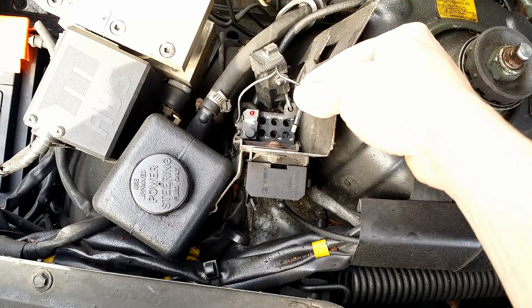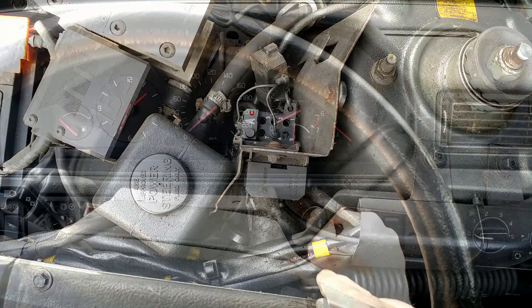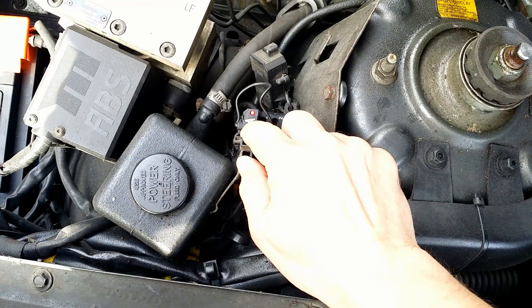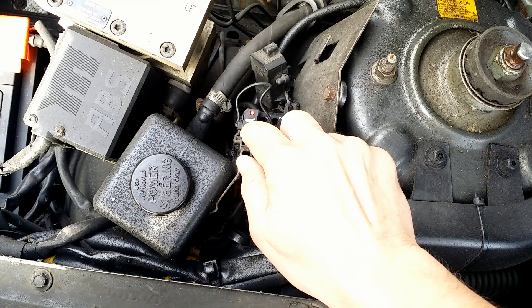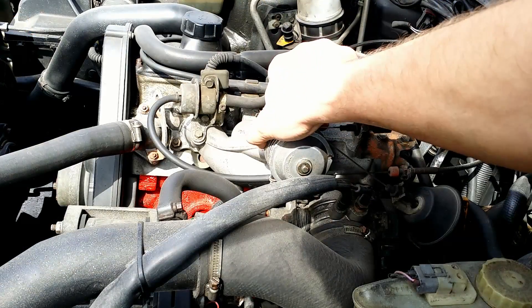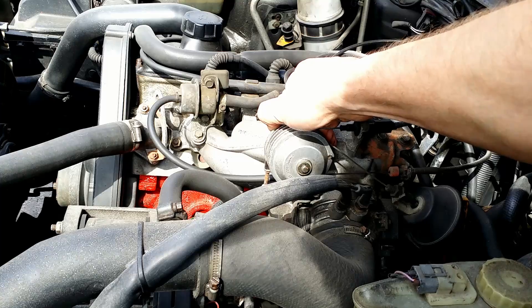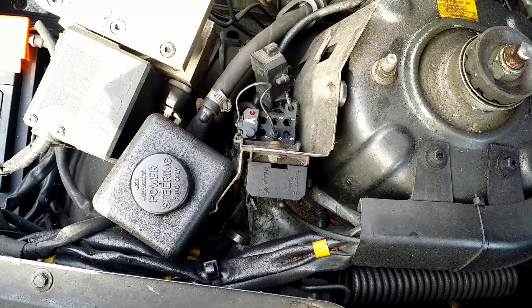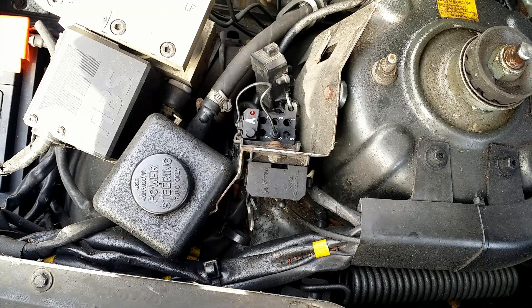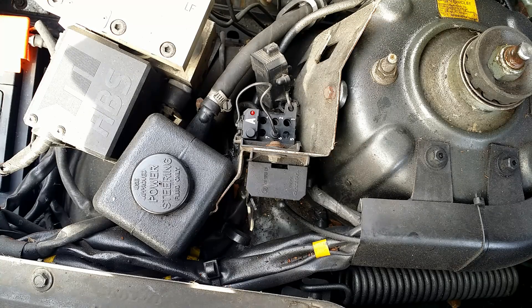For the next test, I plug the cable into port number 6. Ignition on. I press the button 2 times for about 2 seconds each time and let go. The LED starts to blink and I turn the throttle cable spool. The throttle switch is testing and it reads code 3-3-4, which is the right code.